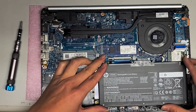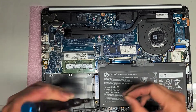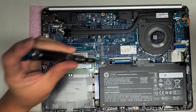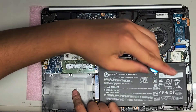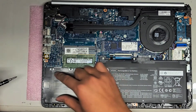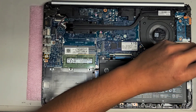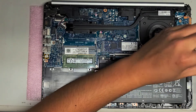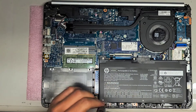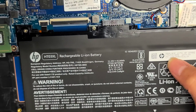Make sure you push down here to get the battery connector seated. Now just put back the screws. It looks like this had a place where it can fit a 2.5-inch SATA hard drive, with the connector right there — but you do need to buy the cable adapter, so I'm not sure where you'd buy that, but it is possible to upgrade. There's another part number on the battery: the HP part number is L11119-855.